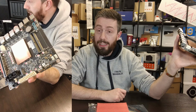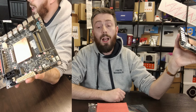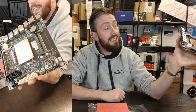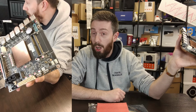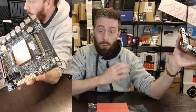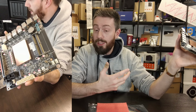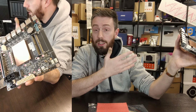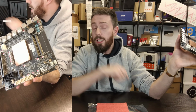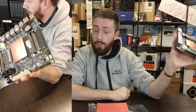Now, in terms of integrated graphics, it arrives with a Radeon 780M that at burst can go up to 2.7 gigahertz, which is a pretty high performance number for integrated graphics. That has to be said. This is a Zen 4 Phoenix CPU, so again, we're seeing a lot of the modern stuff in terms of Gen architecture, with Gen 4 at 20 lanes to spread across the system. So, you know, comparable to that of some of the Intel cores that we talked about recently.